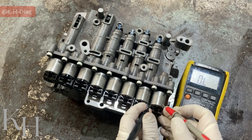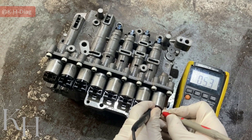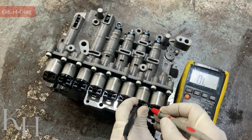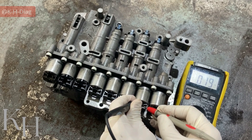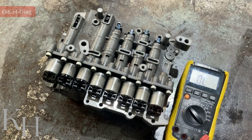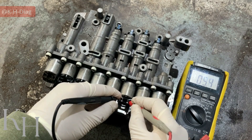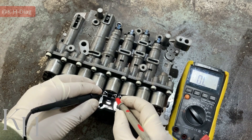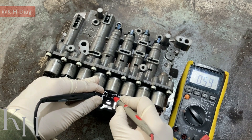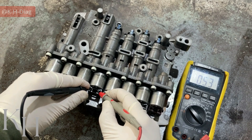Starting here — if I measure the resistance for the torque converter solenoid valve, I'm getting 5.3 ohms. The second one, the 35R solenoid valve, gives me 5.3 again. The third one, which is the 2 and 6 solenoid, same resistance — 5.3. Fourth one, which is UD brake — 5.3 again. And this one for overdrive — still 5.3. So up to here they are all 5.3 ohms.